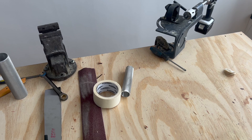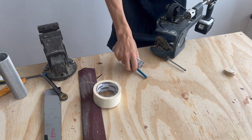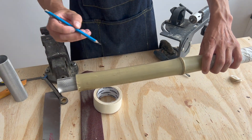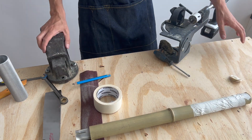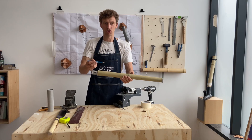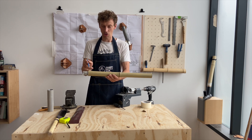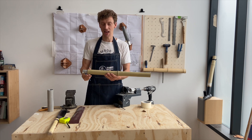I'm going to put this insert inside the bamboo and allow a long area between the top of the seat post and the node. The benefit of that is I can have more of the seat post inserted into the frame, giving less stress around the top of the frame. If you're doing your seat post at home, make sure the node is not too close because it might stop the seat post from going fully in.